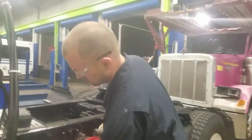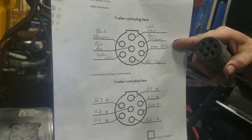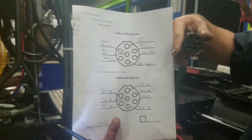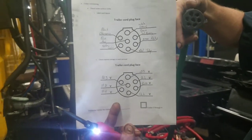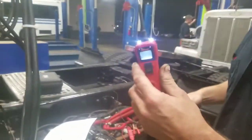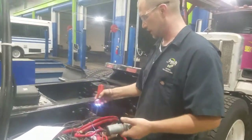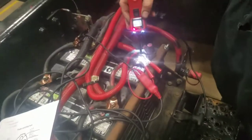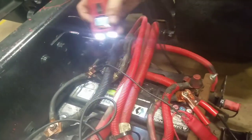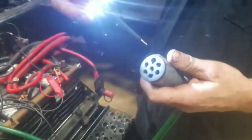We've established our coordinates for all the wires and our voltage. What we have here is a power probe — we're going to be using that today instead of a voltmeter. You connect it between negative and positive and test your meter on either side, which will give us a good ground and a good battery voltage at 12.1. That gives us a reference.